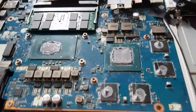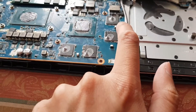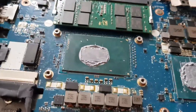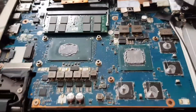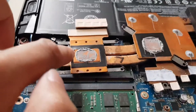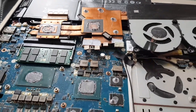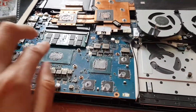Okay, so this is the dot method as you can see. On these it didn't cover anything on the VRMs — covered absolutely nothing. On the CPU and GPU I put a bit extra on so it did cover it, but as you can see it didn't do well. You can see the bare metal, which is not good — you should not be able to see the bare metal of the chip. That's why it was overheating and failing. You can see the coverage of the whole chip isn't great, and there's quite a bit of pump-out effect as well.